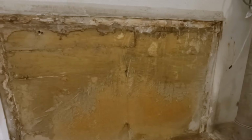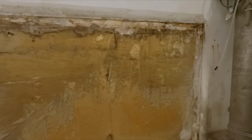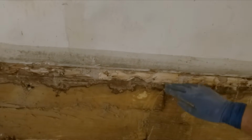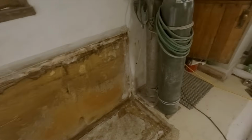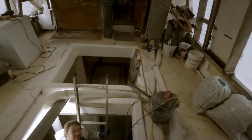So we're just going to grind that off and get it cleaned up and probably throw a layer of 45 and a layer of mat on there to thicken it up a little bit. This line here we suspect was just reinforcing that water catch gutter that was on the actual box. It looks pretty good. It's ugly right now, but we're really happy with the space that opened up. You can see a big pile of rubble right here too, so some more stuff to haul off.